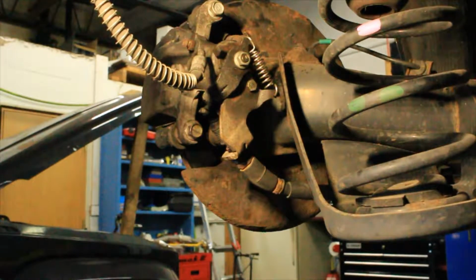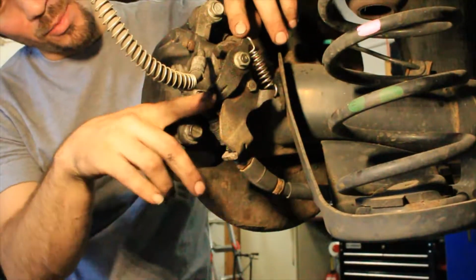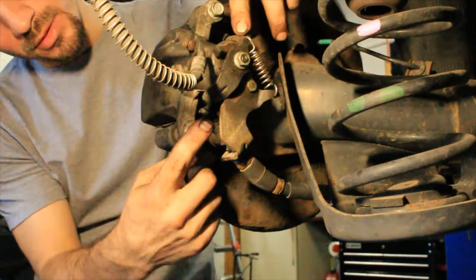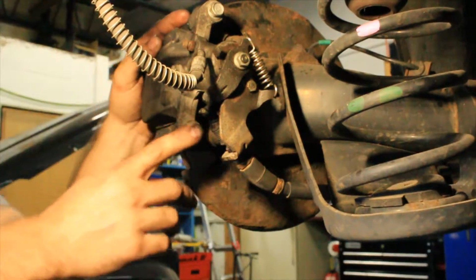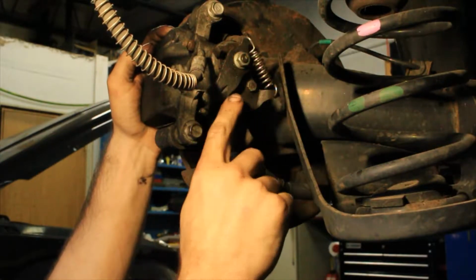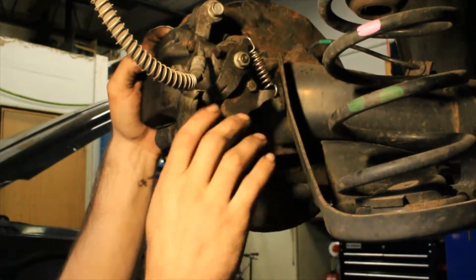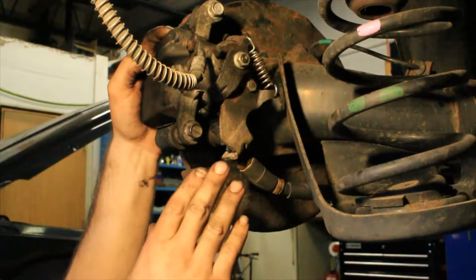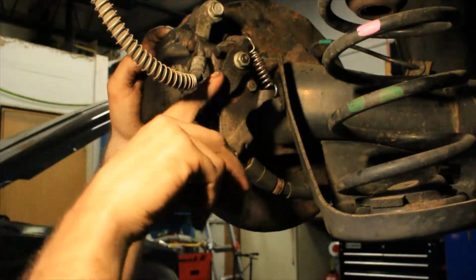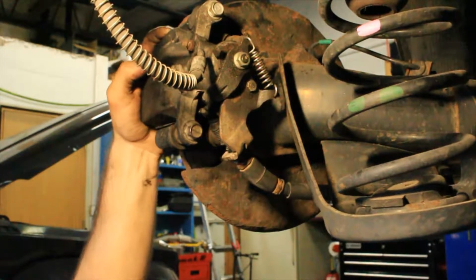Okay, so you guys just got to witness what happens when you pull the parking brake. Our parking brake mechanism was sitting here, our lever, and when we pull the parking brake, the cable pulls it down to this point right here. An easy way to identify that is because the bracket that physically rotates on the caliper is now nearly touching the bracket holder for the cable. There are different styles as far as how these are mounted, but what I'm trying to show you is this lever comes down via pulling on the cable, which is pulling on the handle inside the car.